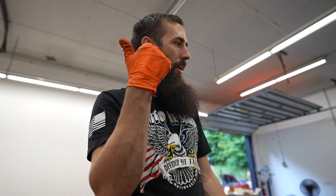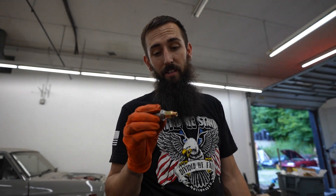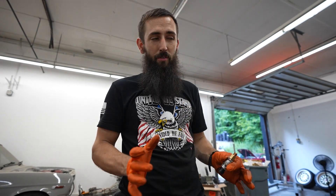Installed fluids: poured oil in it, hooked up radiator hoses, did transmission fluid, differential fluid, front differential fluid, transfer case fluid, and a little bit of brake fluid. One thing I thought of right before putting the starter in — we didn't have an oil pressure sensor. We swapped to an RB20-style oil housing to get rid of the stock cooler, but it didn't have the factory provision for an oil pressure sensor. We're running an aftermarket WHP sensor from ECU Master USA — I actually sell these on emotionalperformance.com.